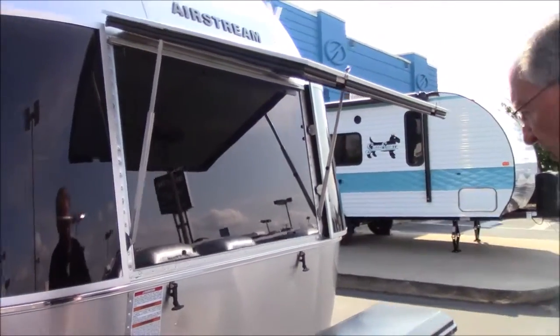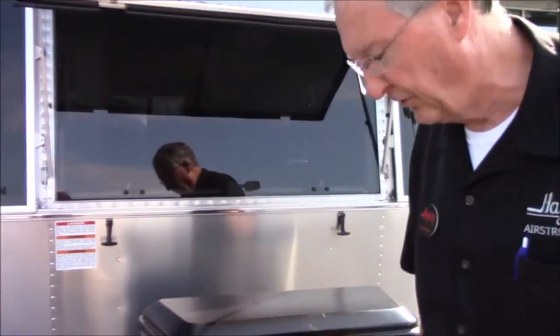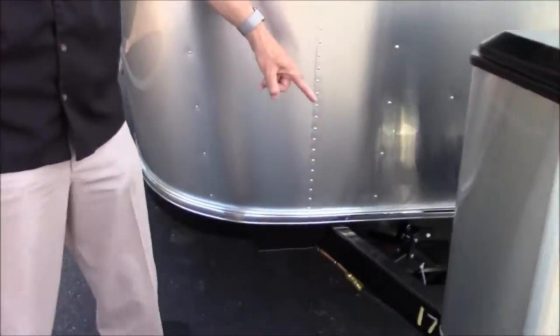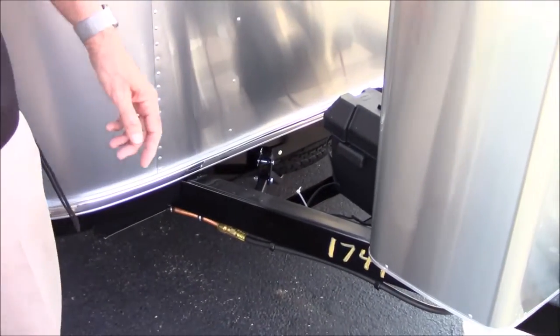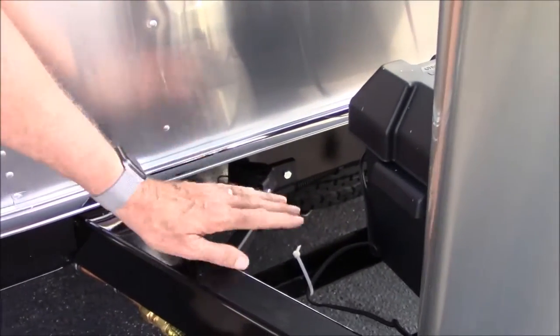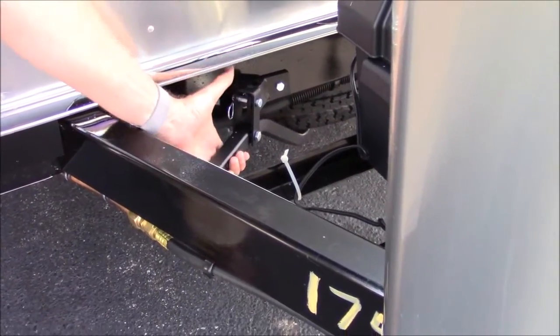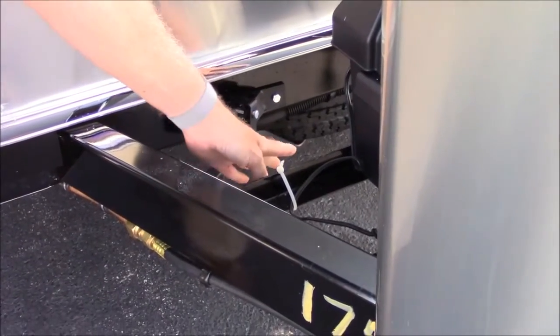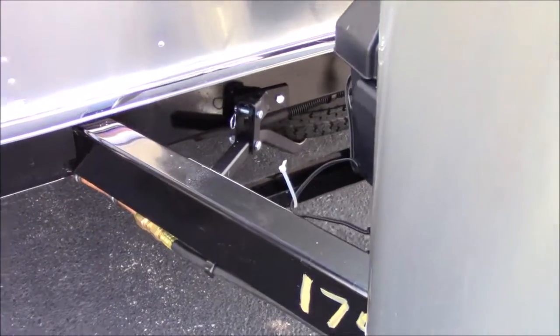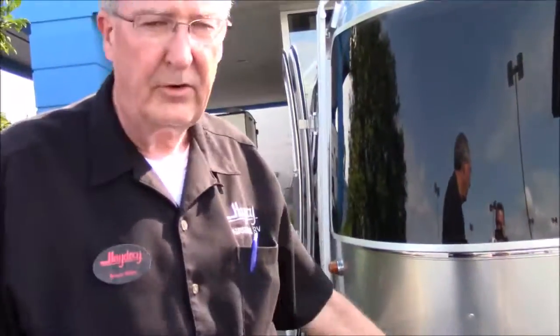When we close this, there's a little trick I'll show you on these little bungees - they can be a bit of a challenge. When you pull them tight, they kind of go right through your fingers. Your spare tire is right underneath here, right up front. If you ever need it, it's real easy to get out. All you have to do is pull this little pin right here. The spare tire is still not going to come down - this metal piece up here is what's holding it up. Once you've got that pin out, grab this right here, put your thumb here, lift, pull that back, and then lower it down and the tire will slide out. If the front of the trailer happens to be low, simply use the tongue jack to raise the front of the trailer up so you have enough clearance to get the tire out.